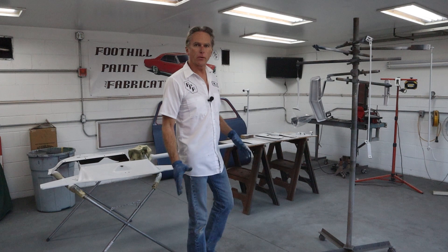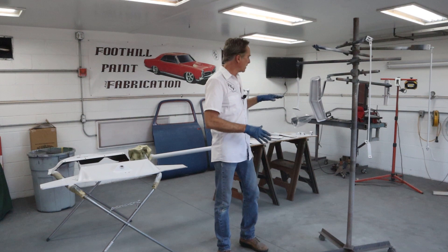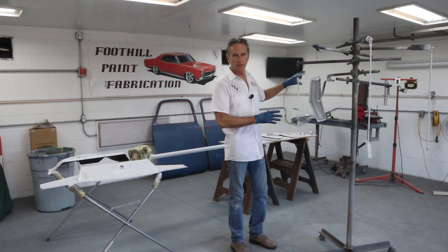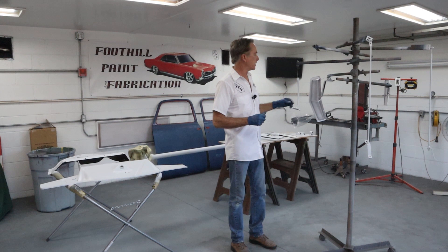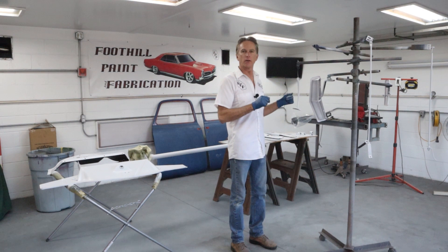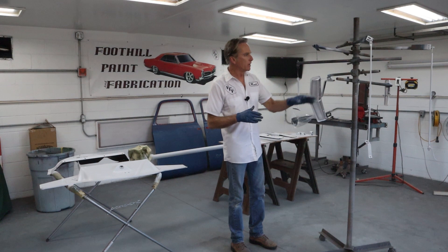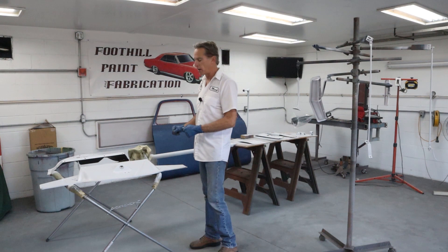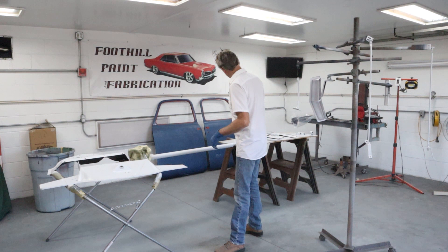We're going to let that flash off a little bit. The mirror arm — I want two coats on that. The two vent covers I want two coats on, especially over this old red here. I see something going on here — I'll have to put a double coat on. I want to try to seal that up because it keeps bleeding through the primer, and I certainly don't want a reaction when I'm spraying the base coat on. So I'm going to let these flash off a little bit and get another coat on — maybe even two more coats — just to seal that up really good. Then I can do all my final sanding, it'll be ready for color, and I can set it aside and spray the blue on it later. I'll go over these to make sure everything's covered really well, and hit these just a little bit since they're kind of scratched up. There were a few dents I knocked out. And I can see I missed a few spots on the shifter. So let everything flash off and I'll go over it again.